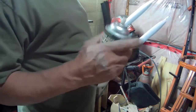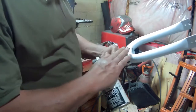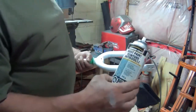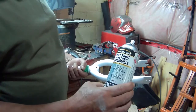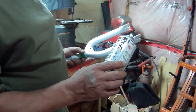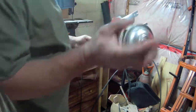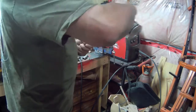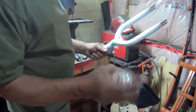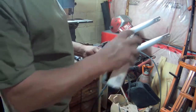I got that sanded. The child's mother wants the whole bike painted red. The paint I'm using is Rust-Oleum armor coat rust paint, high gloss. This is the paint I use for all my bikes and go-karts and all that. I used 120 sandpaper here. I'm going to give it a first coat, let that dry, and then half an hour later give it the second coat.